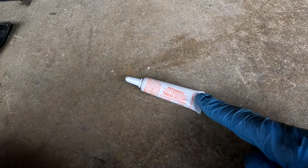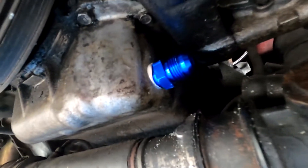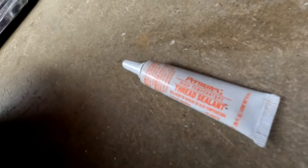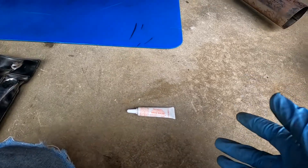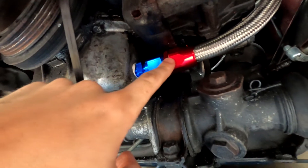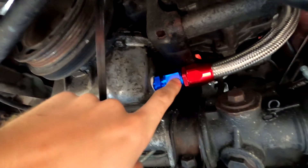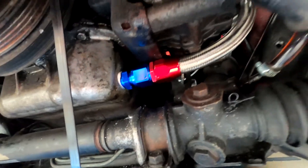That thing is on there. I used this high-temperature thread sealant — a lot of people use JB Weld for this, but I didn't have any and just wanted to get this done. This high-temperature thread sealer should do the trick. Don't use Teflon tape because that can melt and end up clogging up your oil system — use something like this or JB Weld. Now I'm working on getting the approximate position of the fitting. I'm going to have to use the straight fitting down here — I wanted to use the bent one at the bottom, but the straight one is really the only one that fits. I cut it pretty close with that AC compressor stuff, but that looks good.